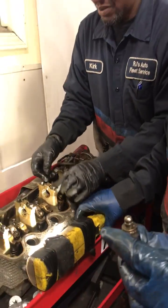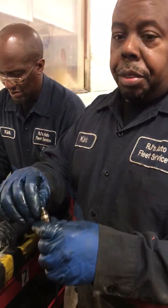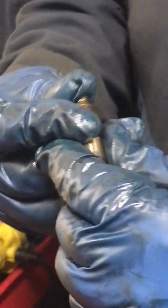What I'm also doing — these are your push hydraulic lifters, and what you do here is you take them out and you push them. They should be solid, hard to push. Now if there's any kind of play where they go up and down with ease, you want to replace those. So we're checking those.